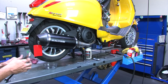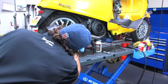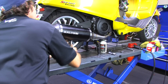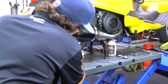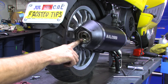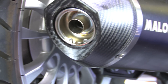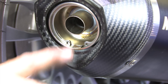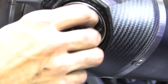One of the internal ratcheting wrenches makes it much easier, but you're going to need two wrenches to get behind it because you won't have much room for a socket. The Malossi pipe includes a removable internal baffle. If you remove the baffle, you may gain more upper-RPM horsepower with the aid of some additional fuel tuning. Removal of the baffle requires you to grind the small tab prior to removing the circlip, then pulling the baffle out.